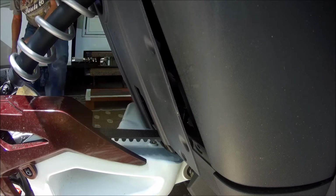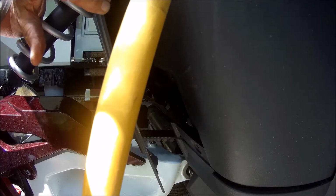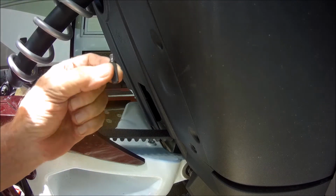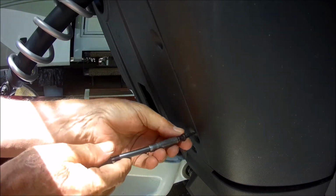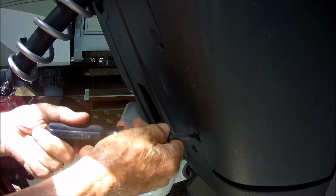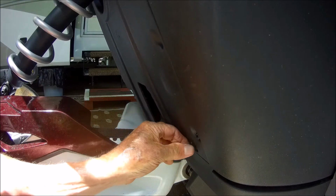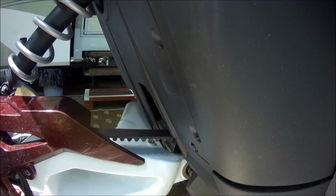And my little tool here, my bobbin tool, right here. There. You've got to have a tool like that. Okay, this is a T25 Torx bit that you can take these side screws off. And now I'm going to put them all back in, but I'm not going to make you watch. I'm going to line them all up first, and then there's one push pin down here that I've got to push in, and there, and same on the other side.